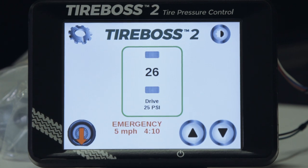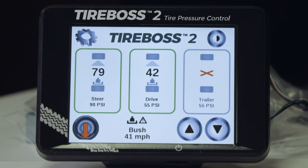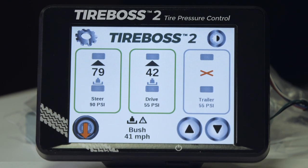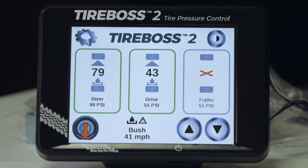Please note that changes in tire pressures take place while the vehicle is in motion — this applies to both inflate and deflate changes. Inflate times are much quicker when the vehicle is in motion than when still, given the engine RPM and turbo boost increasing compressor output. For vehicles equipped with load sensing, it will automatically display only the settings available for that condition; for example, loaded pressures will be different than unloaded pressures. This shift between loaded and empty happens automatically without your input.